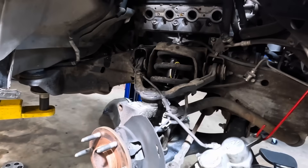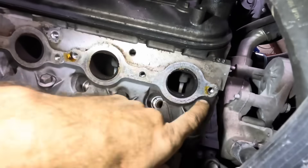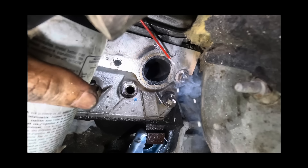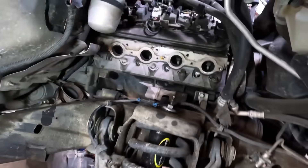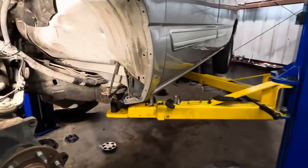The vehicle also had some very nasty exhaust system leaks. We found on closer inspection that some of the bolts that hold the manifold to the cylinder heads were broken off — two on that side and one on this side. In the last video, link in the description, we did the teardown segment, got the manifolds off and managed by some miracle using the welder to extract the broken off bolts.